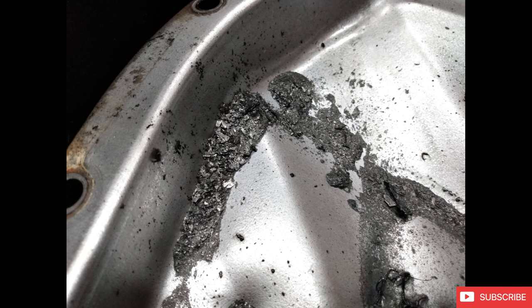Pretty easy to just drop the motor in. Because the motor's going so far back in the engine bay, I like to come in from the side. The lift, like I said, makes it a little bit easier, but certainly you don't need a lift for this. You can do it on jack stands or whatever. It just takes a little bit of creative positioning of the cherry picker. The motor itself fits really nice. We all know how compact and easy to fit the LSs are, and it's a big contrast to the big overhead cam stuff, the two valve, three valve, whatever Ford motors.